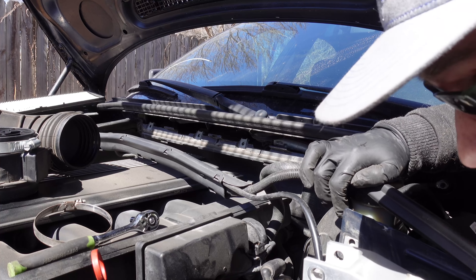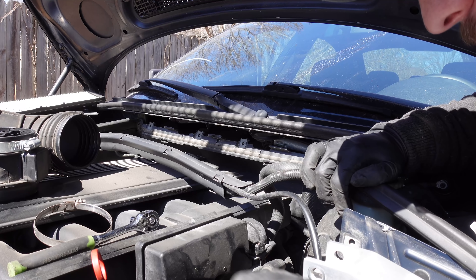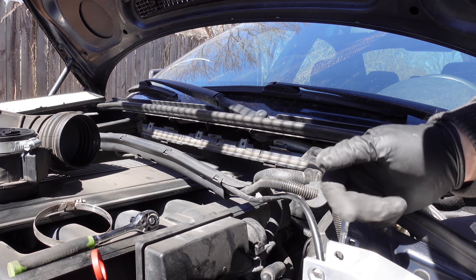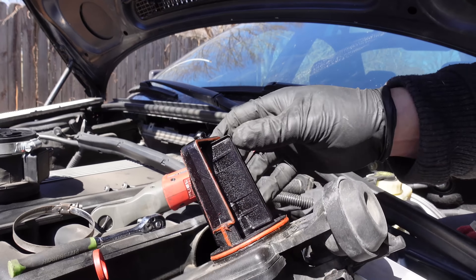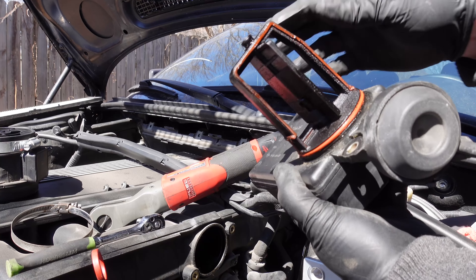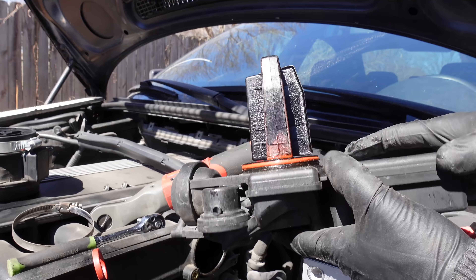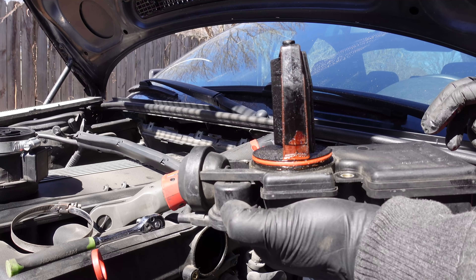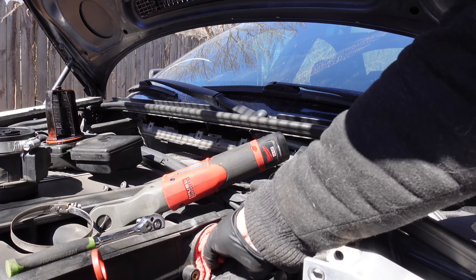What is next? Looks like the DISA is probably the next thing to take off — it has a bolt here and a bolt here. If you're going to check or replace your DISA, this is probably the point you'd want to get to. I have done it with that plastic shield still in place. It sucked. It wiggles right out, and I have replaced this O-ring. Things to check for: make sure this is not loose or rattling. That's how you check if it leaks — if it leaks down over time when you put your thumb over that diaphragm, then it's bad. This one is good.